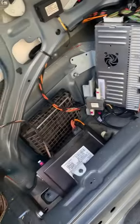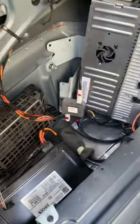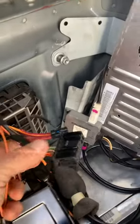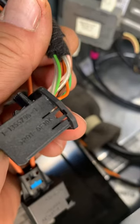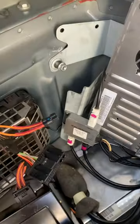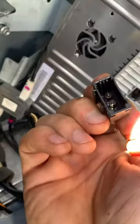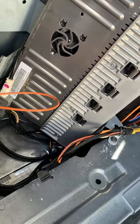In my case, my system was going crazy just from this module here. So what I did was I actually took this fiber optic out of the connector — just like that. There's a little thing you have to press on the side here, you just press that and it comes right out. Then I just loop the system with this tool, just like that.